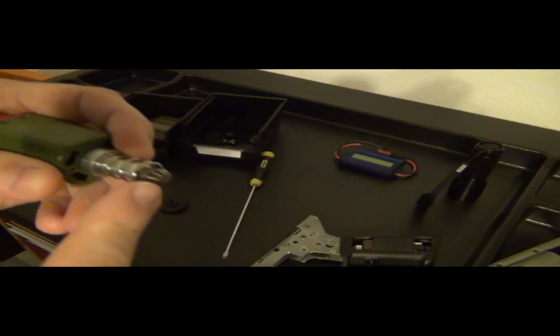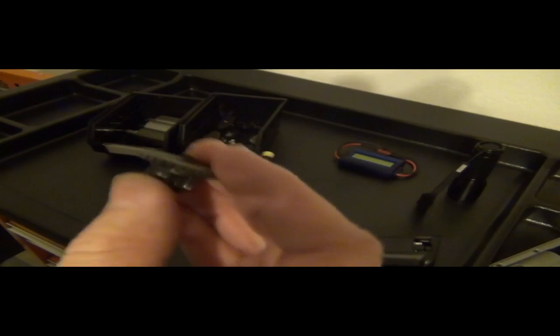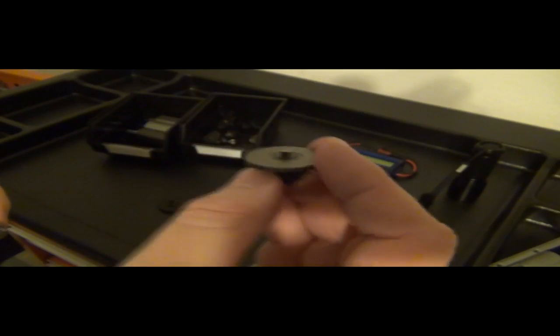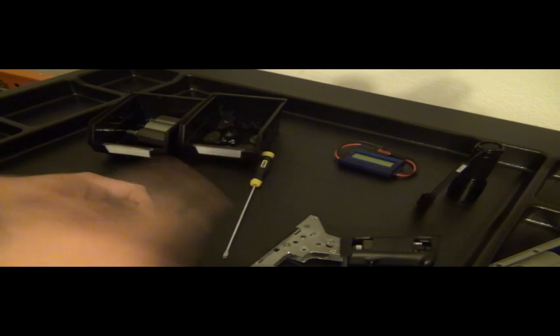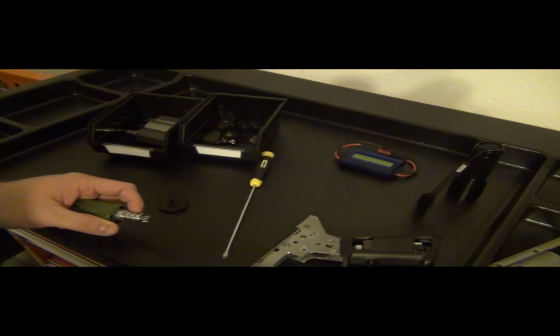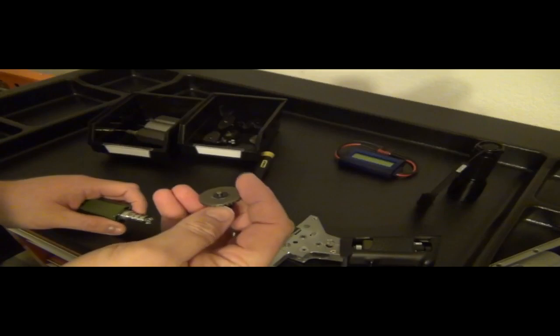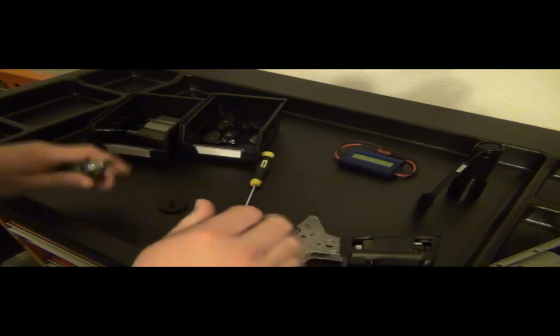The idea is to get enough of these teeth here to be able to rotate this bevel gear, but also keep the bevel gear flat, parallel, straight in the mech box. Okay? That should make 100% sense to anyone that understands mechanically how gears rotate. You do not want to add extra resistance. You want it to be as simple as possible to turn, with no resistance.